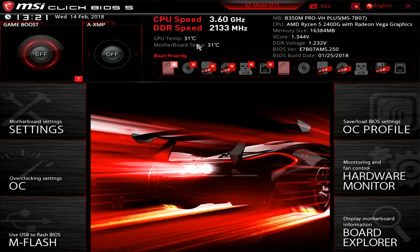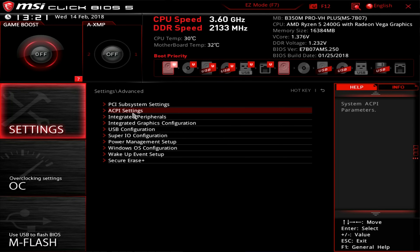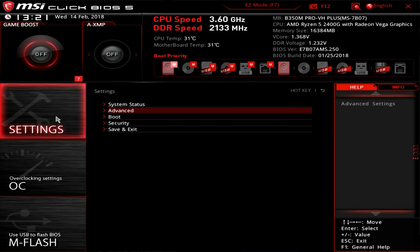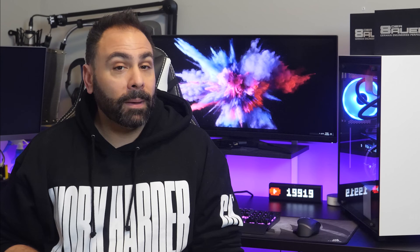Unlike with your standard CPU and discrete GPU setup, all changes to both the CPU and GPU here are made in the BIOS, so you'll need to know your way around the UEFI. For MSI's setup, in order to change your VRAM configuration and make any of the changes we'll be working on today, you'll need to switch over to advanced mode first. Then head into the Settings menu, Advanced, and then Integrated Graphics Configuration. I can't guarantee the menus will be identically named on all motherboards, but just look for something similar and you should be in the right place. Once we're in here, you can see the option to adjust the frame buffer size from 32 megabytes up to 2 gigabytes. If you have 16 gigs of system memory, I would definitely recommend kicking this up as high as you can.